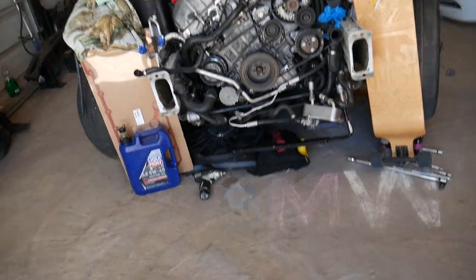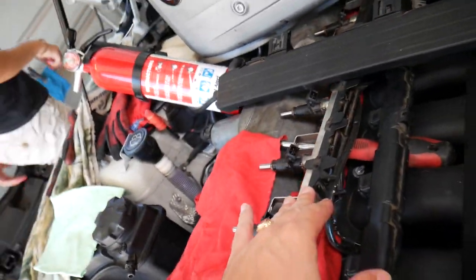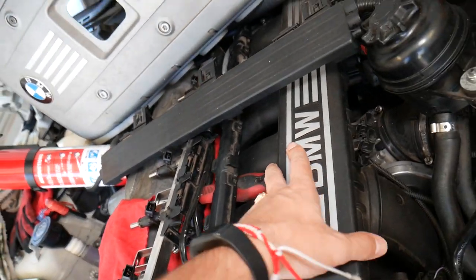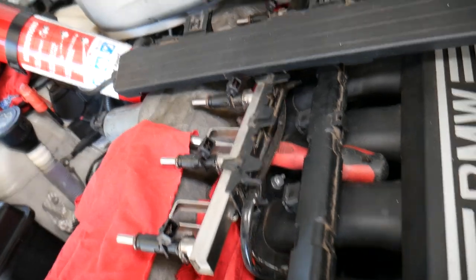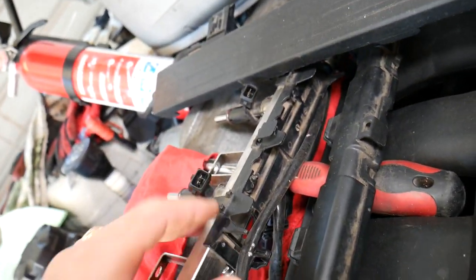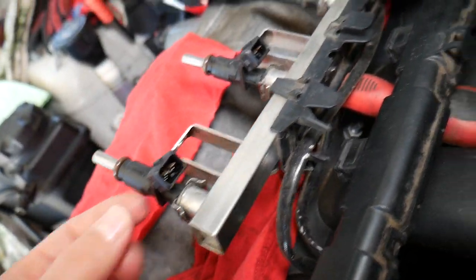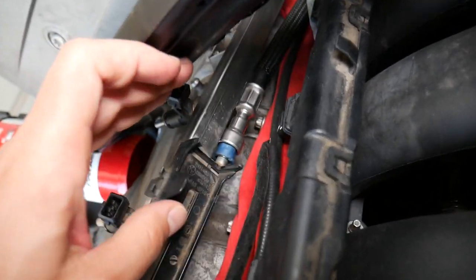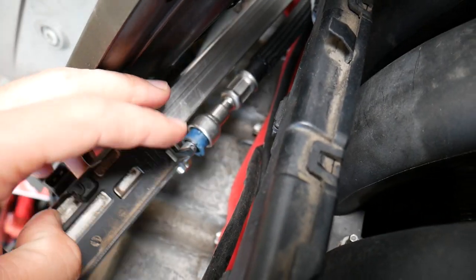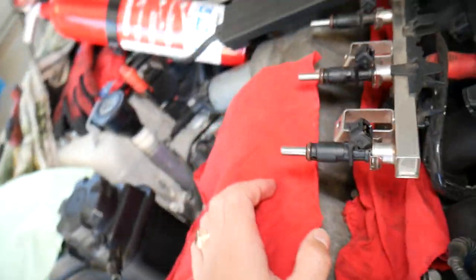Let us show you what we have here and how we are going to test it. This is the fuel rail right here. If you have the X5 with the N52 engine, you have your air filter box on top and you won't have that plastic that says BMW, but it can be easily removed. We have the fuel rail removed all the way with the fuel injectors. The fuel rail is the pipe that feeds the injectors fuel, and it's connected to the fuel supply line coming from the fuel tank, so we still have pressure in the fuel system.